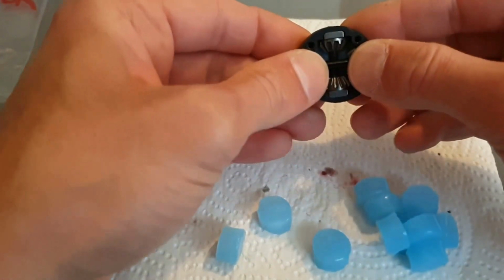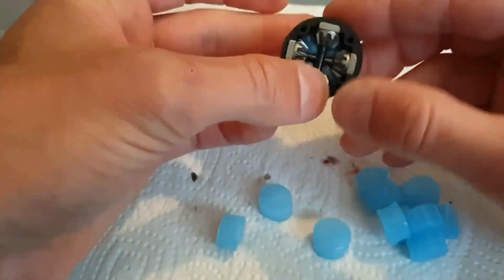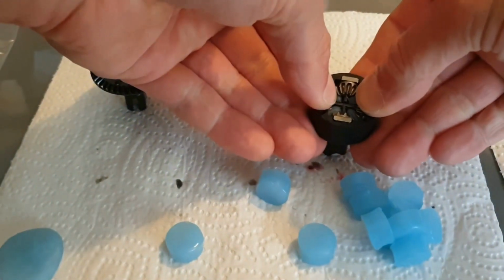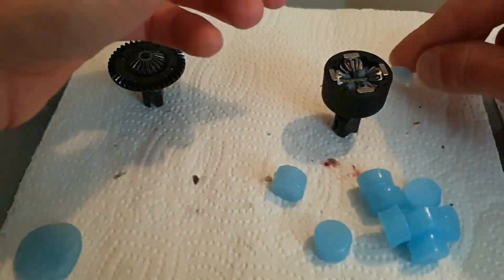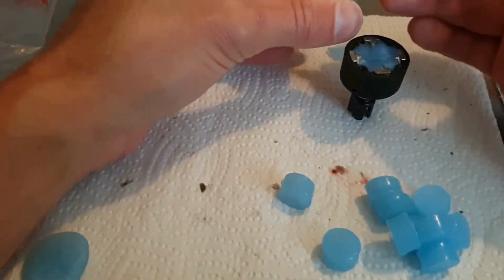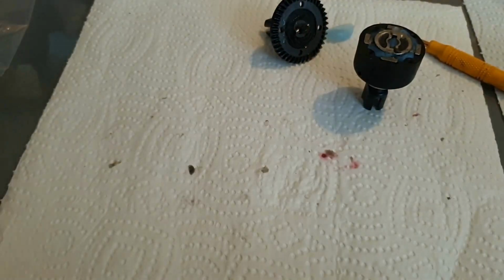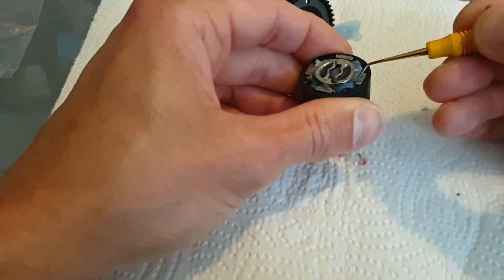Silicone earplugs are not your conventional differential fluid, so a different filling procedure is needed. Personally, when I fill up a differential up until the thickness of 2 million, I just put in all the spider gears, cross pins, etc. Put the differential on the table or in a stand, fill it up, wait so that the differential fluid can sink down, add a little bit more differential fluid until it is full. With silicone earplugs it doesn't work like this.